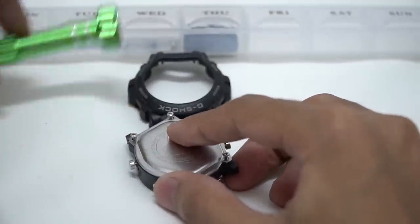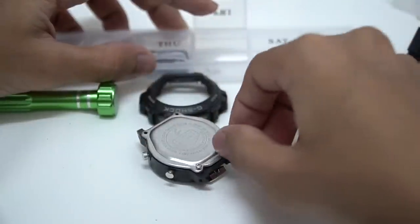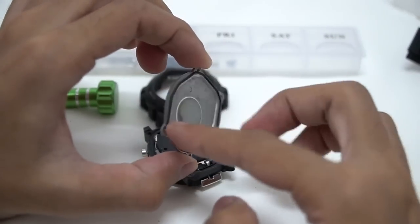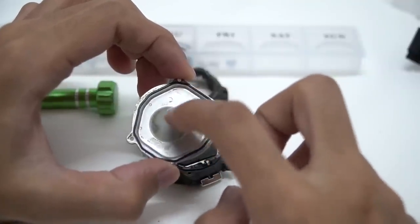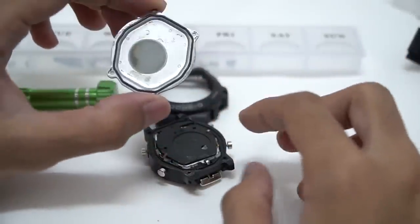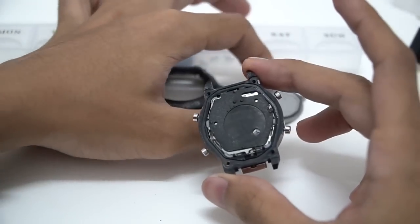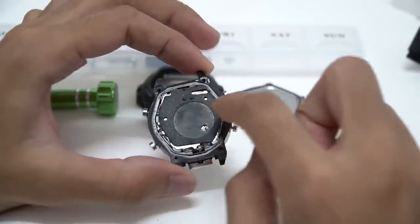Just in case you want to swap the battery — this watch is over 10 years old, so the solar rechargeable battery has already expired. I should replace it but I don't have any spare parts right now. This is the back plate. Up here, if I'm not mistaken, this is the buzzer — it's what makes the watch beep each time you press a button. Up here is the O-ring, which has an unusual non-circular shape. You should re-grease this part for water resistance — you can see it's already dry, and this watch is rated 20 bar water resistance.